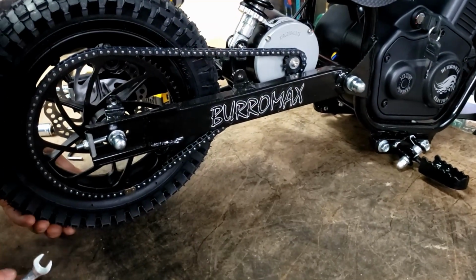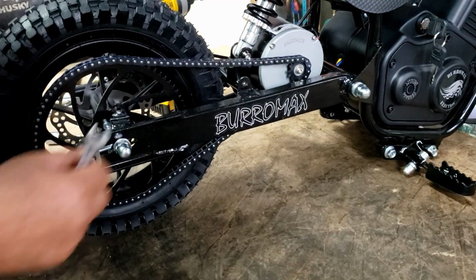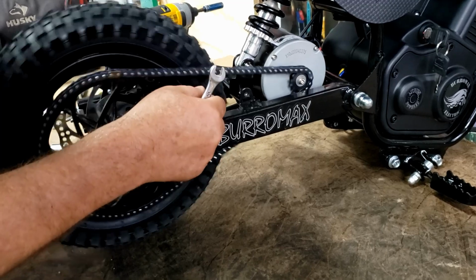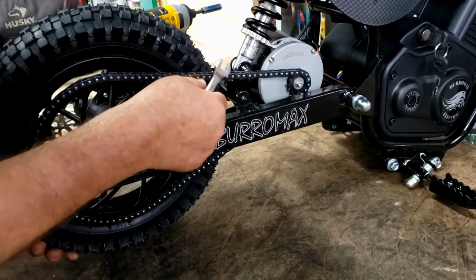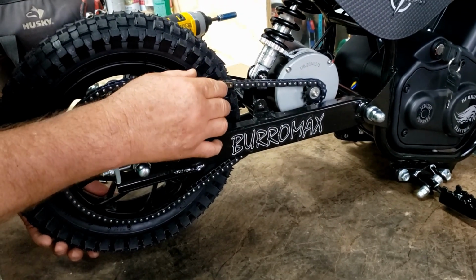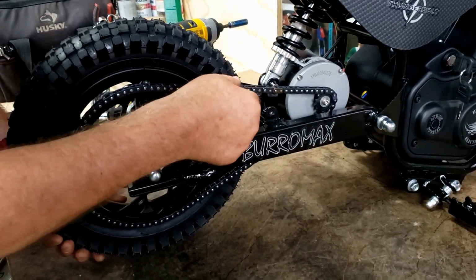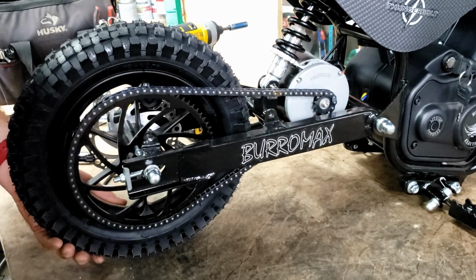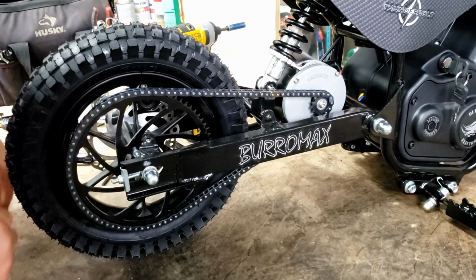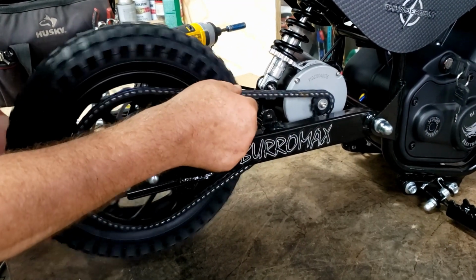This is too tight. The 750 you got to preload a little bit, so you got to pull just a little bit on it to get a real feel of where you're at. And that's in the loose spot. And this is in the tight spot. So as you can see, this is the tight spot, and this is where we want to know where our play is. So we need like a 1/2 inch of free play in the tight spot. It's very tight there. You can see it's too tight. So we're going to loosen it up 1 flat. That's good. So that's our tightest spot.